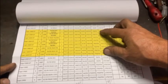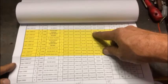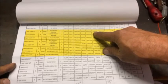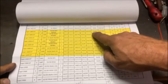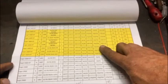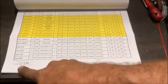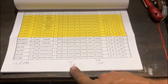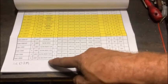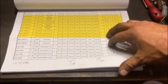I prefer the F6 emulsion tubes. They've got F50 on the first choke and F6 on the second - I would have had it the other way around. The F6 gives you nice low-down grunt, but then you put in smaller mains. Anyway, I used a 32 DFM on an A14 with 145 and 140 mains. There's also the 32/36 DFV - it doesn't really matter too much.